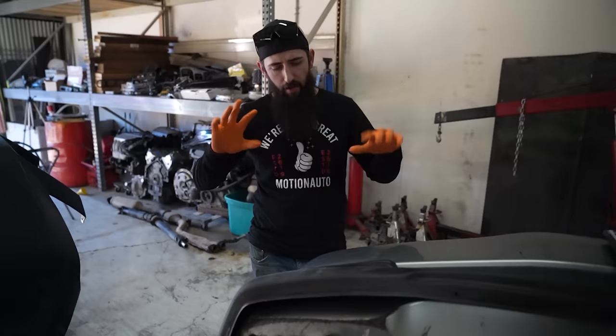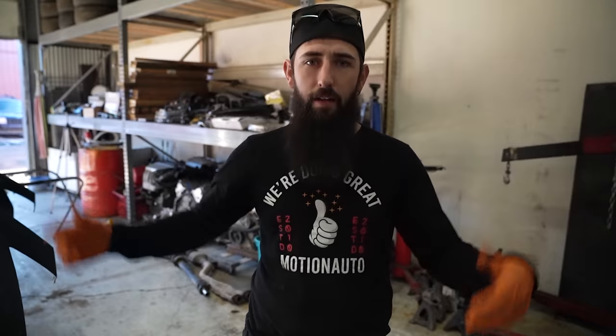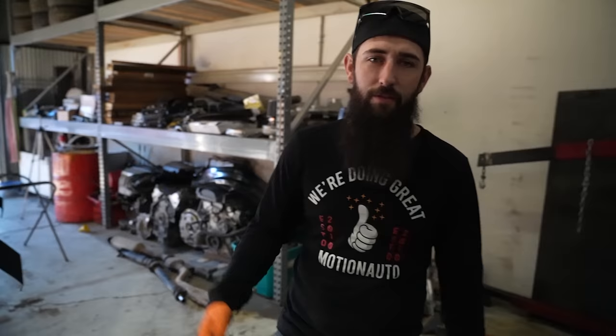Paint is pretty malleable for the first week or so, depending, because it's still gassed out, it's solvents and it's not completely hardened yet. The other thing is paint normally isn't 100% cured for more than 30 days sometimes. So if you ever paint a car and drive it somewhere and it's sitting in the sun, you can just smell it. Sometimes you go to a car show and you look at it and it's just like a fresh painted car. That's usually how my S14 used to be. A couple of years ago, I'd go to the drift event with fresh paint from 2 days before.